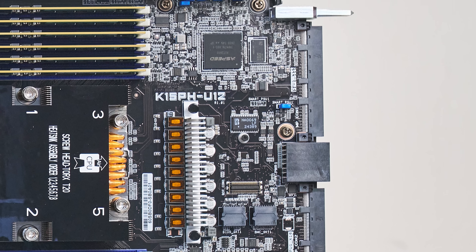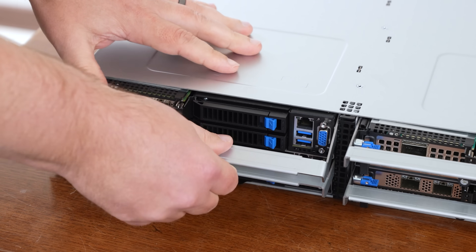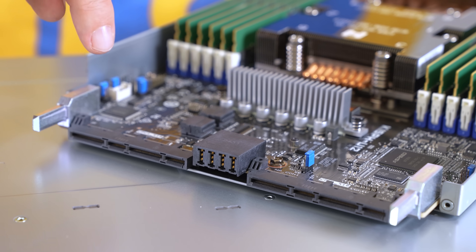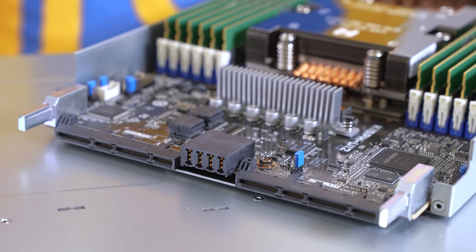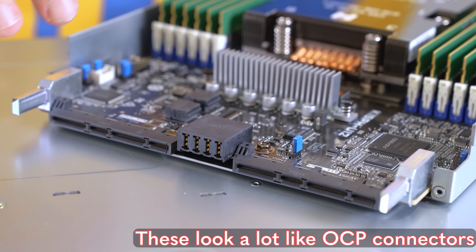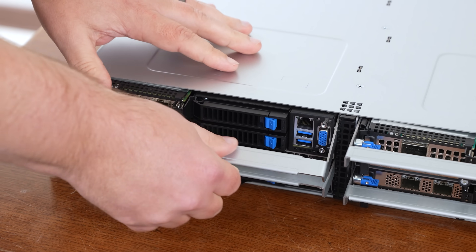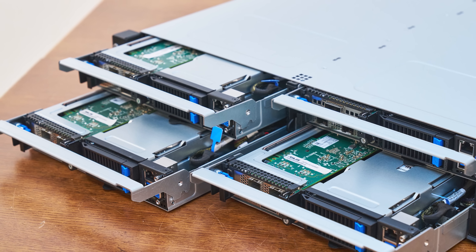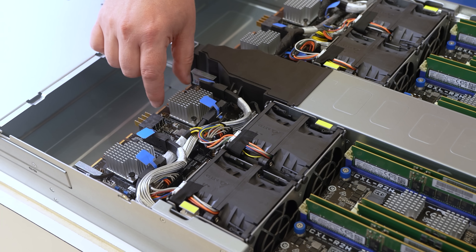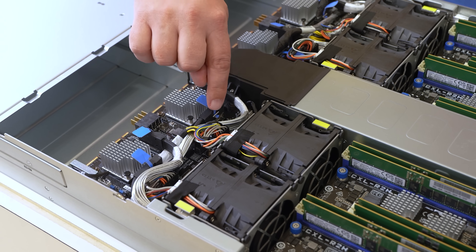All the way at the back of the node, you'll see features unique to this system. We have guide pins to make sure you're inserting it into the chassis correctly. We need power in the node, so there's a connector for that. Then we have two connectors that are PCIe Gen 5x16 — these go to the midplane and allow CXL or PCIe out of the back of this node. The nodes slide in, stacked one on top of another, connecting to power and data at the rear. The PCIe Gen 5x16 or CXL communication happens here, with a re-timer so the signal can be re-timed from the original board to the midplane board and out through the cables.